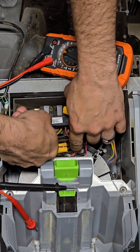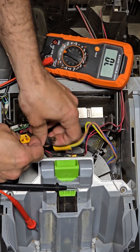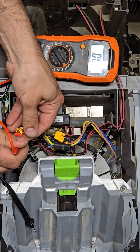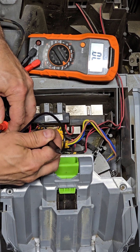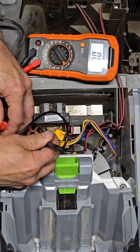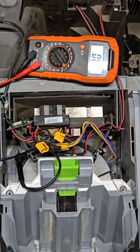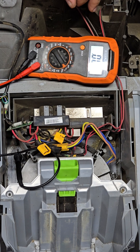Let's take out the motor connection and the main power connection and grab the parts that go to the electrical assembly. Switch to diode mode. Take the red probe and put it onto the black lead, then take the black probe and test each one of these three connections. That one's 0.2, that's 0, and this one we're getting 0.6. We have two that are way too low and one that's way too high. Your number should be between 0.45 volts and 0.55 volts. So this unit is bad — we need to get it replaced.